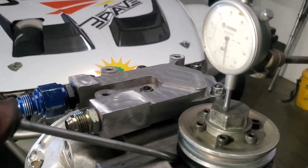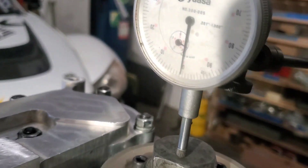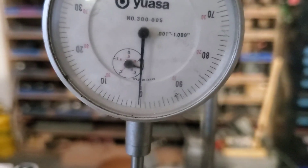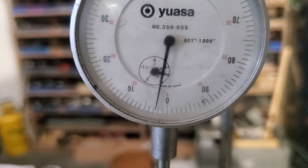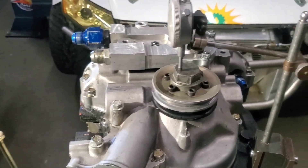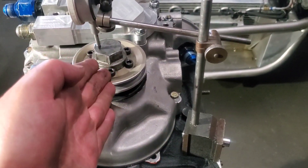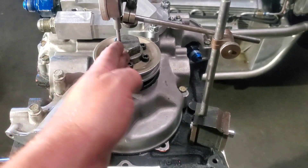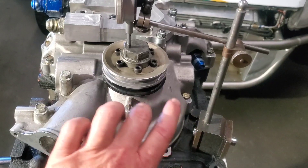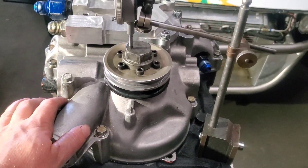If we get in close here, you can see with just very light pressure — two thou. I'm just sitting off to the side. 2.2, 2.5. My zero is slightly off right now. So if you're looking to do this yourself before the front cover is on, we'll often assemble, torque down your front pulley to proper OEM specs for whatever the block may be, and then check the front end play and float. That spacer — it's all getting checked before the front cover ever goes on.